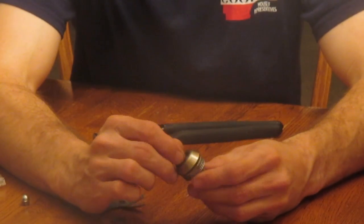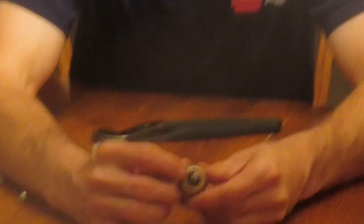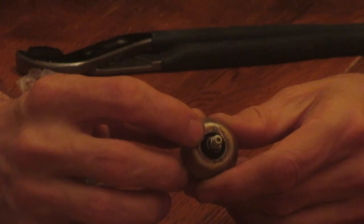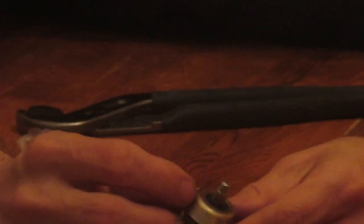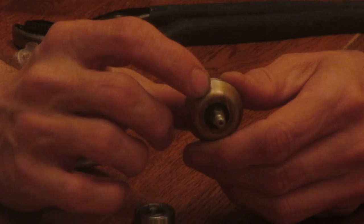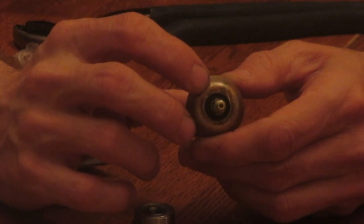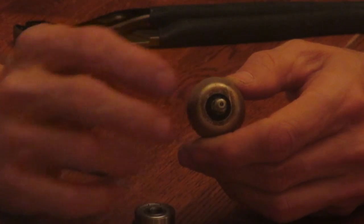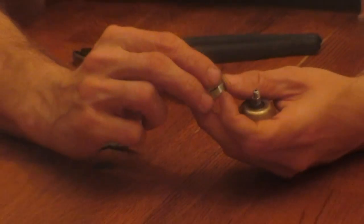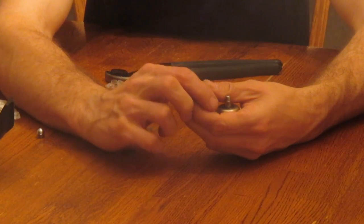The only trick to this whole piece — right down inside there — there's actually a small piece of rubber with a small O-ring. That O-ring sits in a milled spot on the inside of this piece of metal. When you're pressing that out, make sure you don't damage it. Then you can simply slide it back together. But if you would damage it, I don't see it being a major issue, because as long as you put it back in there for the spacers, you'll have the better bearing and shouldn't have to worry about it.